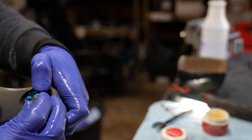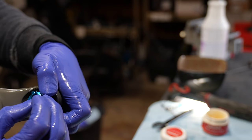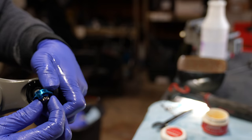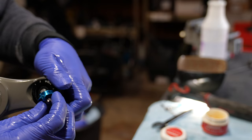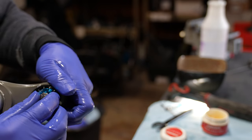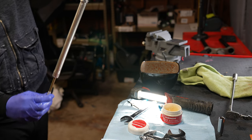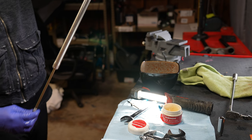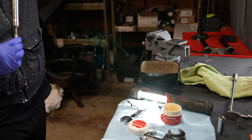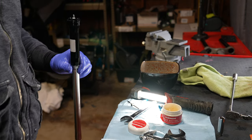You need to line this up — it is a little bit challenging. Basically spin the low speed compression knob to line it up in the compression needle — it took me about 10 minutes to get it perfectly lined up. Fully left was on number one. Before sticking it in the bike, make sure the rebound rod goes all the way up — that way you know you set the IFP height because there's the right fluid displacement. Put it up to your ear to make sure there's no air trapped inside — you'll hear it crunching if you've got air.